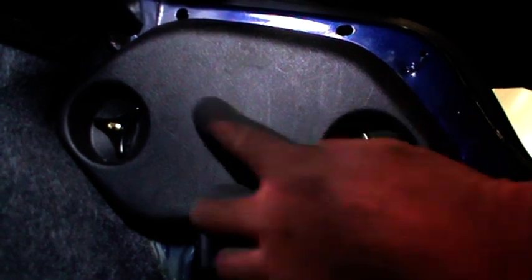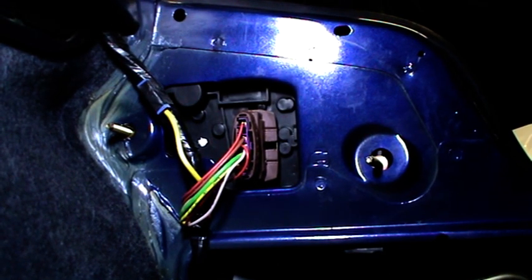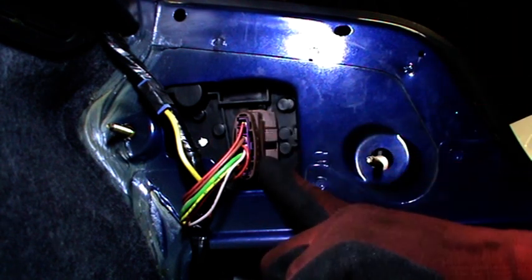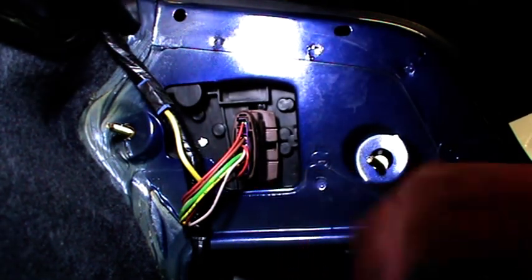Moving around to the back - the other half of the assessment is to remove and check the rear lights of a vehicle. To access these bulbs and remove the actual lens assembly on this particular car, it's held in by these two fixtures which simply just spin off. There are two of them, one on each side. That removes this panel which accesses the bulbs but also releases the lens from the vehicle. In this situation you just have to have one hand on the lens on the outside, so that when you remove the last screw the lens doesn't just fall off and hit the floor. I've removed the outer cover - the connector is very similar to the one at the front, with the same kind of sprung bar that you need to press to release the light from the harness.